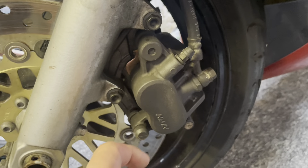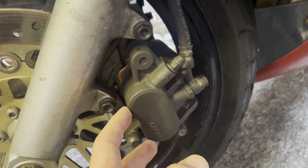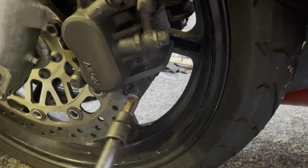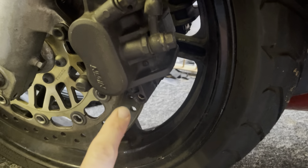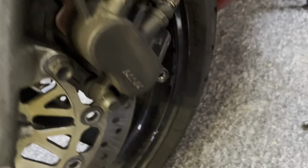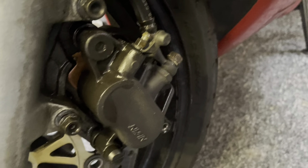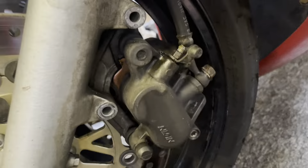Next thing I do is to separate the caliper. Inside this piece here there are two pistons because this is a twin piston caliper, and what I need to do is clean the corrosion off these pistons. There's a little cap in here which has a large flat blade, and that covers the end of the slide which has an allen key in it. All the bolts are loose on that caliper. I've got some brake clean and I'll liberally spray that around the place. This is going to be a little bit of a swine to get off so I'm going to undo these bolts and slide it off that way.